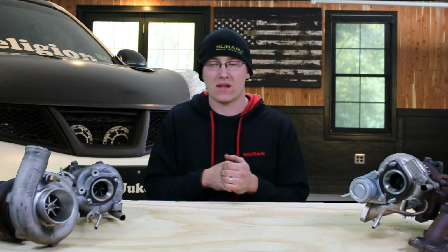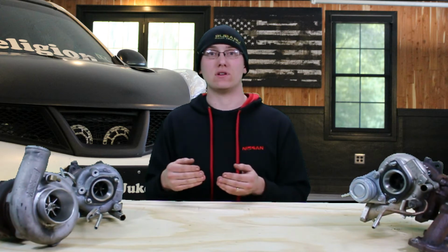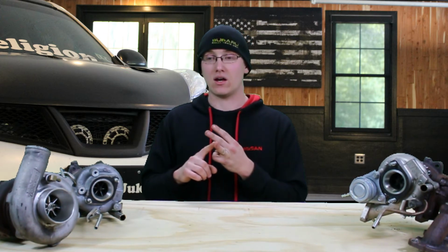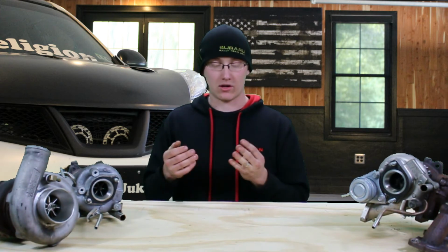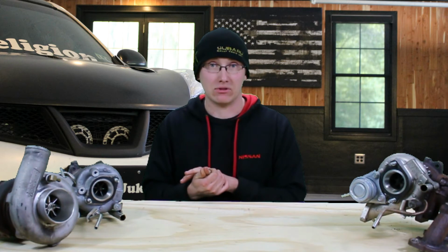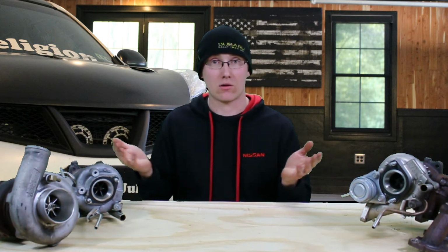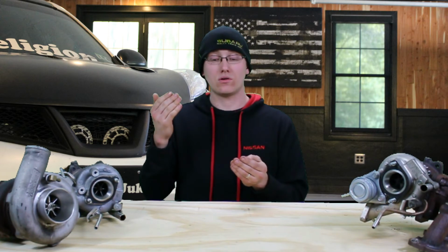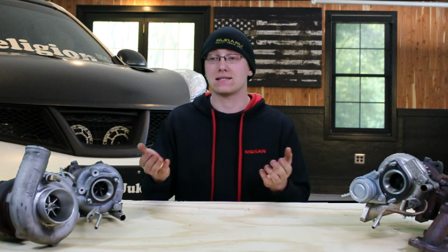Custom tunes, while they work and they're better than your regular stage 1, 2, or 3 tune, again, are not the best thing to do because the data that you are giving the tuner is coming from performance pulls on the street. It's not a controlled environment. You have different air pressures, different ambient air temperatures, different wind loads in front of the car. The amount of speed you can build up is definitely limited. You put a car on a dyno, you can run it up to 140 miles an hour and nobody's going to bat an eye. So I always tell people, if you're interested in getting a tune, spend the extra $400 or whatever it is and get the tune done on a dyno in controlled conditions where you can also see your power and torque gains. You can't see those with a mail-in tune.